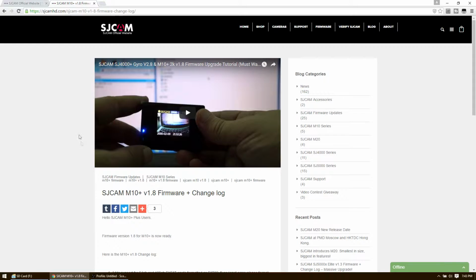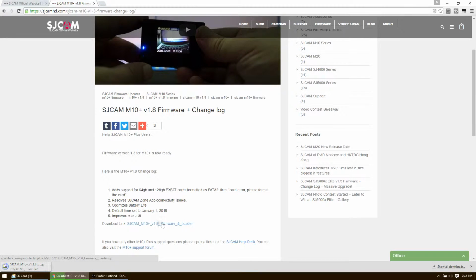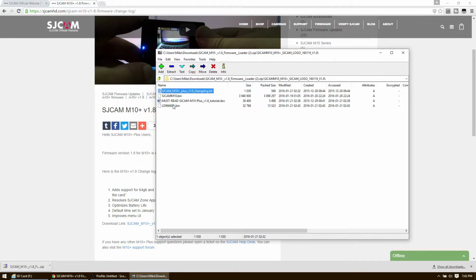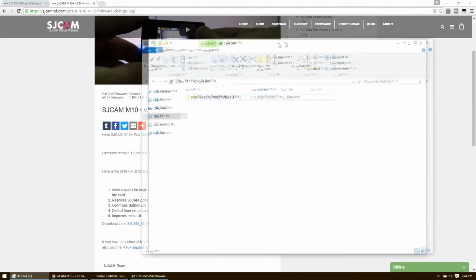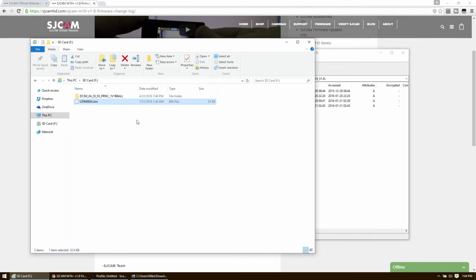I'll include a link to the download page for this firmware in the description, as it's a little hard to find on their website. Just download the zip file and then open it. Inside of there will be a folder, which you should open, and then inside of there will be two .bin files. The one we need is the LD96660A.bin file. That's the loader for the firmware we need to flash first. So copy that over into the root directory of your SD card, and then once it's copied, eject your SD card, stick it in the camera, and let's get over there and flash it.